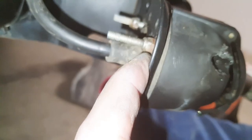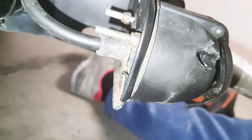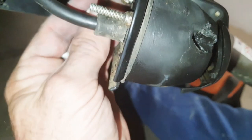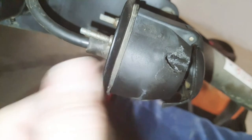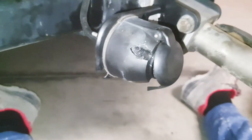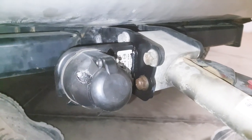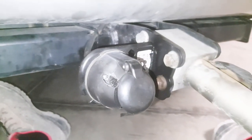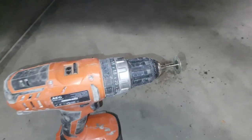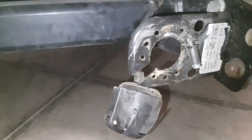There's your little nut, fixed to the plate with excessively long screws. That one looks pretty busted already so it'll come off easy. Once that's off, it's pretty easy - you just tuck the electrics back up and use a cable tie to secure them. My saviour in the end was a little cutting disc - I got it behind the screw and just cut them off, which made life a lot easier.